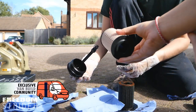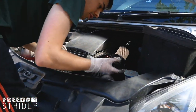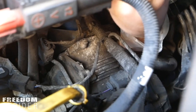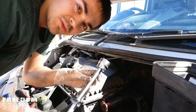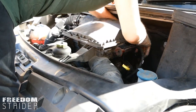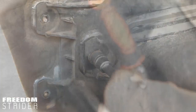All you do is just pop it back on — doesn't matter which way — and it should click like that. The old oil filter is gone, the new oil filter's in here, and you just pop this back in the hole where you unscrewed it from. Then all you do is hand-tighten it. If you're struggling to hand-tighten it, you can get your ratchet, but the important thing is to not tighten it a lot — just as much as you could tighten with your hand. Don't yank on the ratchet, because it's going to get tight over time. You feel when it gets tight, give it a little one and that's it. Now that the oil filter's changed, you can put the air vent back on.